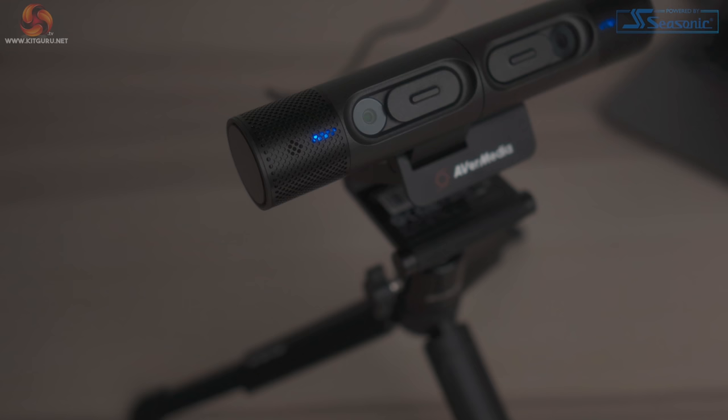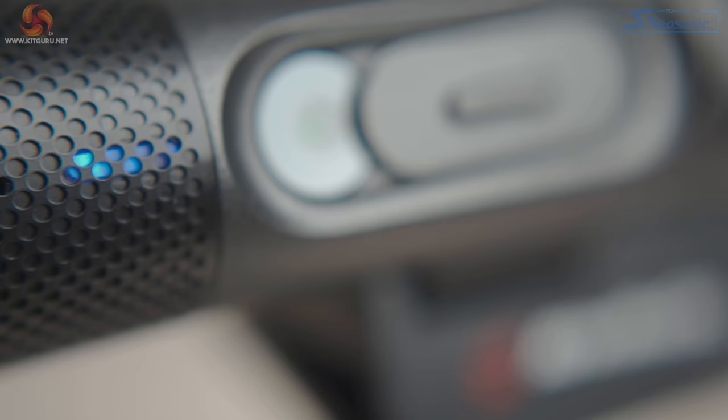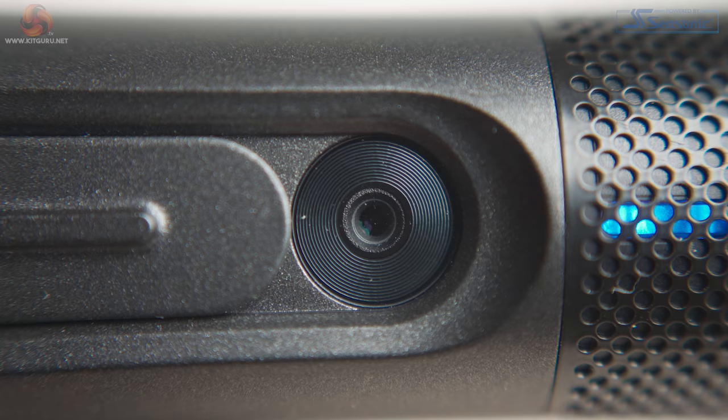Taking a closer look at the webcam: both cameras feature privacy shutters, each side features blue LEDs to indicate when the cameras are on, and there are also two omnidirectional microphones — one on each side — to capture audio based on where you have the camera pointed. The left camera features a 2-megapixel CMOS sensor with an f/2.2 aperture. This certainly isn't a fast aperture compared to a lot of other modern webcams, and you'll see how this affects quality in low light later. The left camera has a maximum resolution of 1920x1080 at 30fps and a 71-degree field of view. In terms of movement, the left camera can be rotated 90 degrees upward and minus 15 degrees downward. This camera pivots from the actual mounting clip and isn't independent like the right camera.